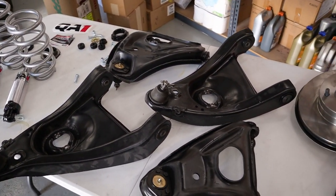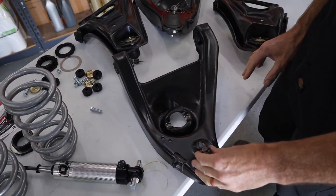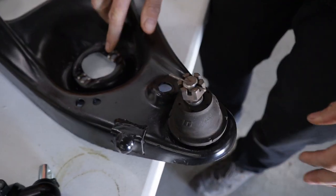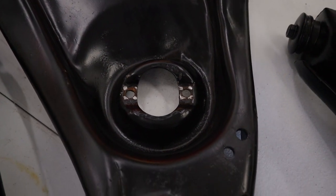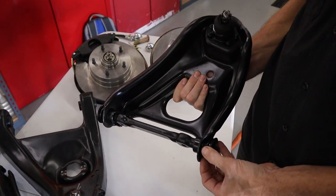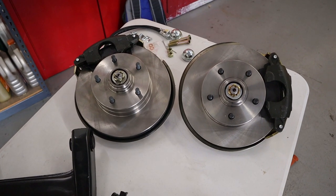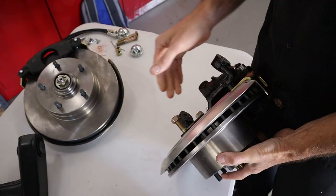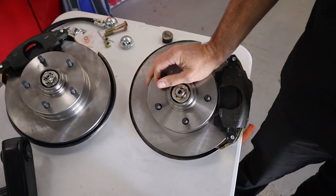These are the parts we're going to be installing on the '67 Camaro. The lower control arms are stock Camaro units that just have new ball joints and bushings. We had to knock off the captured nuts for the original shocks because of the coilovers we're putting on. The upper control arms are the same — stock, with new bushings, new ball joints, and freshly painted. The disc brake setup is a CPP spindles combo. You have to transfer over the steering arms to the new spindle — it's just a basic single-piston setup. The car currently has drum brakes, so we're converting it.